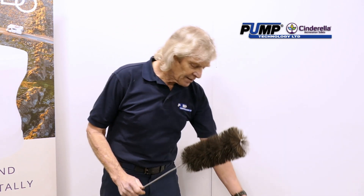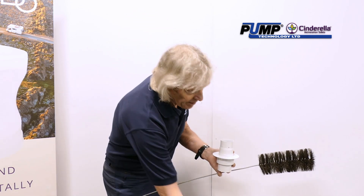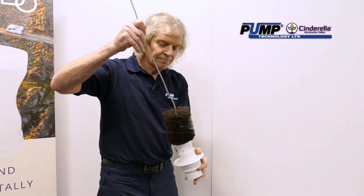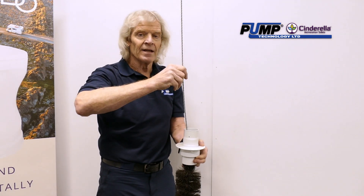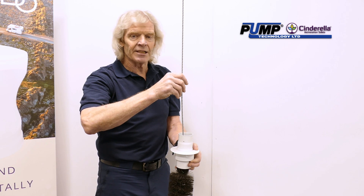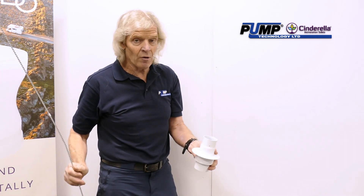With the Travel, this is what you'll have on top of your van or your boat. Just take off the cap and, using your three-inch brush, push it down all the way to the unit below. It's a good idea to have the exhaust fan off and put a little bag underneath to catch anything that comes through, so it doesn't make a mess inside your vehicle or boat. Very simple and very effective, and only needs doing about once or twice a year.